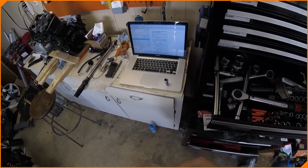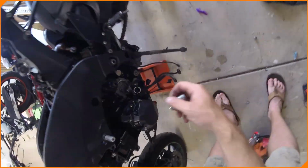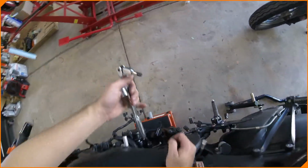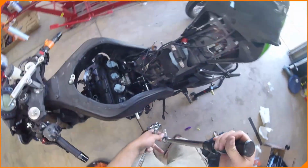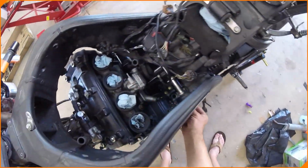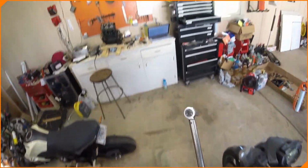And then tighten the middle engine nut and then the lower engine mount nut. So the middle, which was up there, but I put back on there, which is not there, which is right there on the ground. All right, is the torque wrench still set to 32? Come over here and see if this is long enough for this. And we didn't put the nut on there. First we've got to get the nut. Put it on here like this. Get it finger tight in there. There we go, 32 foot-pounds.